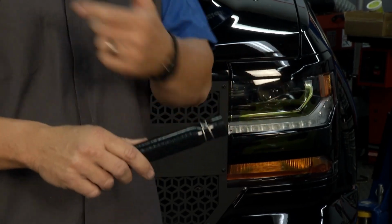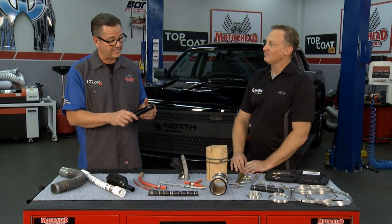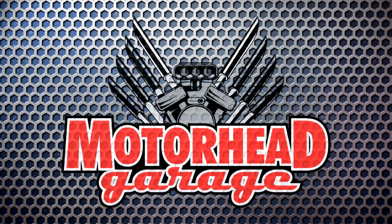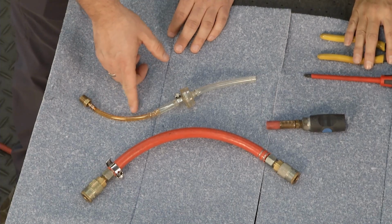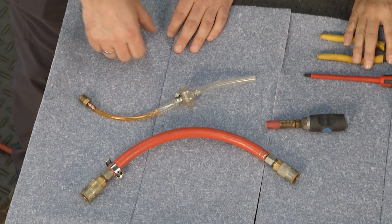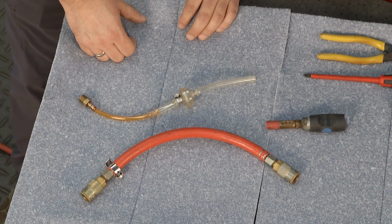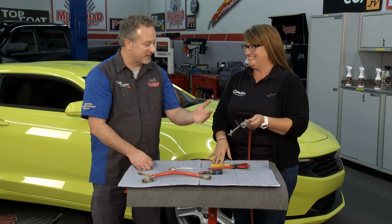Well, speaking of pressure, Dave's over with Nikki, and he's actually clamping a hose that's leaking. That has about 100 PSI of pressure. Let's see how it's going. Now, a clamp-tight custom clamp can hold up to all kinds of pressure. Here, Nikki, we have a hose-to-hose connection. This can withstand up to 300 pounds or so. And if you have a connection like we've got on our air hose, how much pressure can we withstand? Well, that's a barbed fitting, and it's been reported back to us, field repairs on excavators and hydraulic repairs between 4,000 and 6,000 pounds. Holy moly. We don't need that much for our air hose, but we're ready to go.